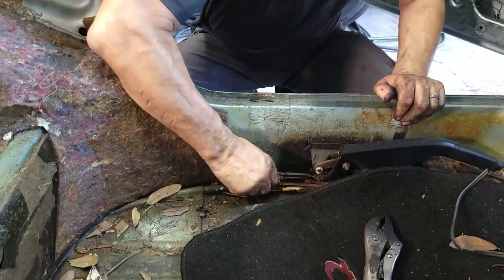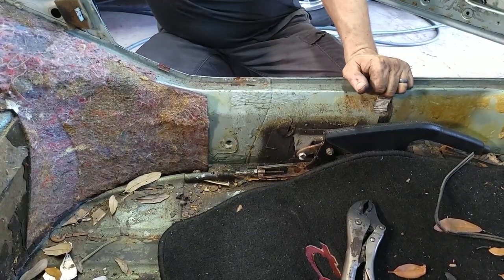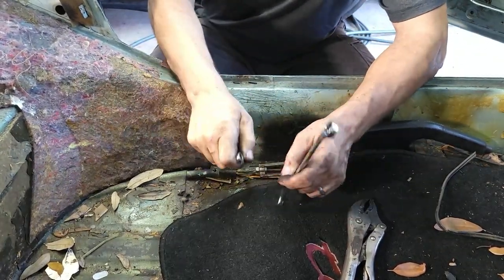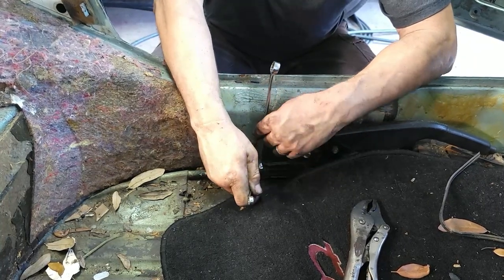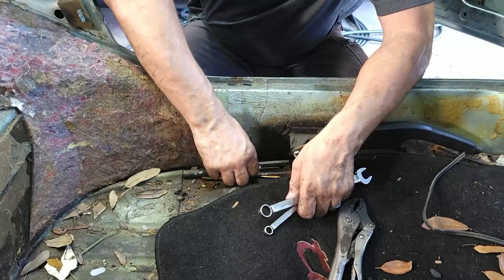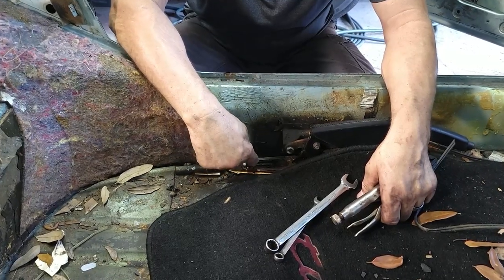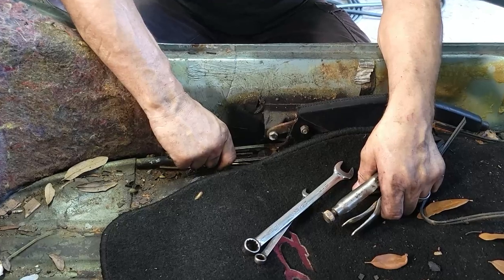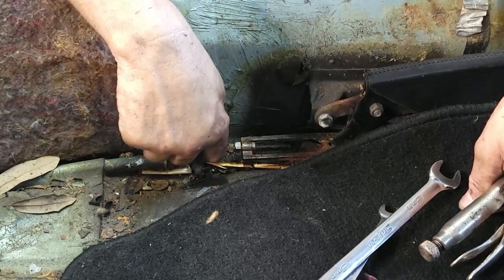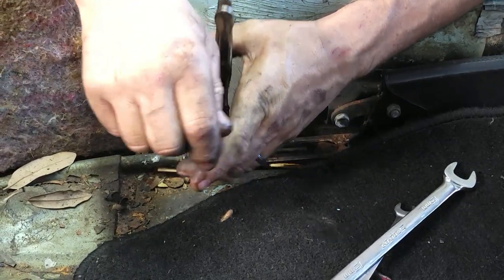I have to take the spring off — it's just got a little 10 millimeter jam nut, and I'm going to need vice grips to clamp that. That's some rusty stuff. This nut is a little barrel inside and it's captured within this little pole mechanism. The cable does have to go that way, so this has to come off whether I have to cut it or if we can save it. We'll do this the right way.